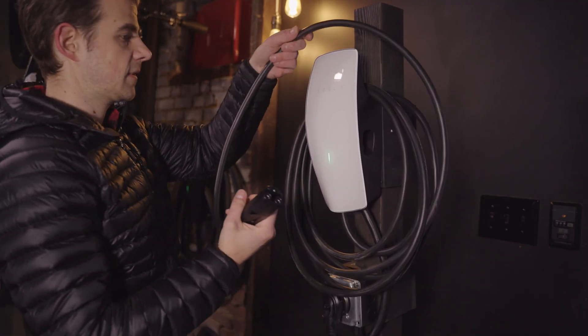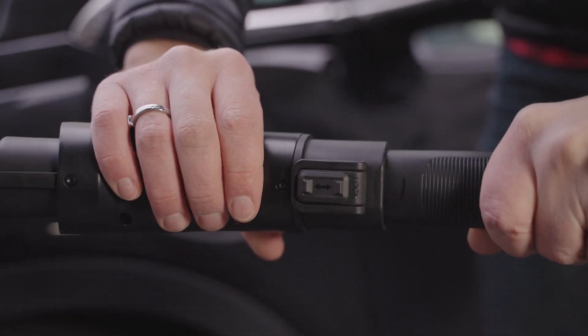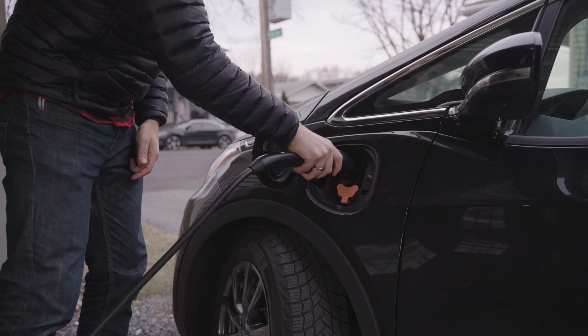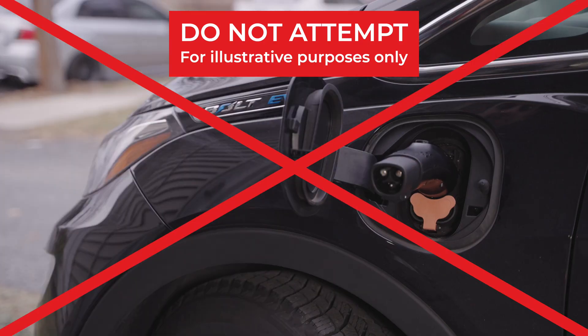Because really, all you have to do is take a Tesla charger, plug it into the Tesla end of the unit, wait a few seconds according to Shockflow, and then plug into your vehicle. I found in practice you didn't have to do it in that order or wait — you could actually plug this into your vehicle and then plug the Tesla end in. But I don't recommend doing it that way because if you do the opposite, you'll fry your power pins. So connect this to the cord, to the Tesla end, then put it in your vehicle.